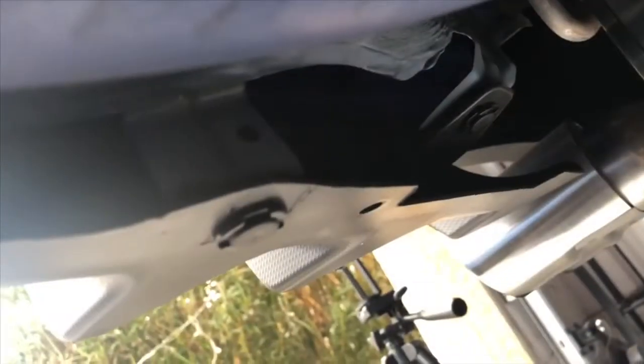So we're underneath the car right now by the rear end. There are four pop clips — that's one and two, and on the other side there's another pop clip, three and then four. After that we should be able to have room to push the rear bumper to have access inside to remove the plastic cover where we're installing the rear brake light.